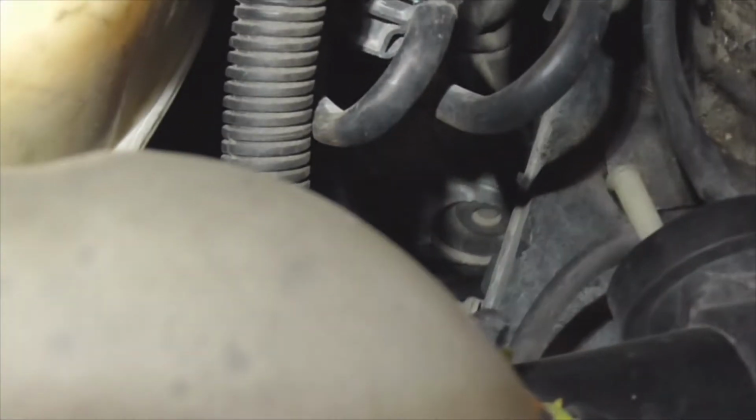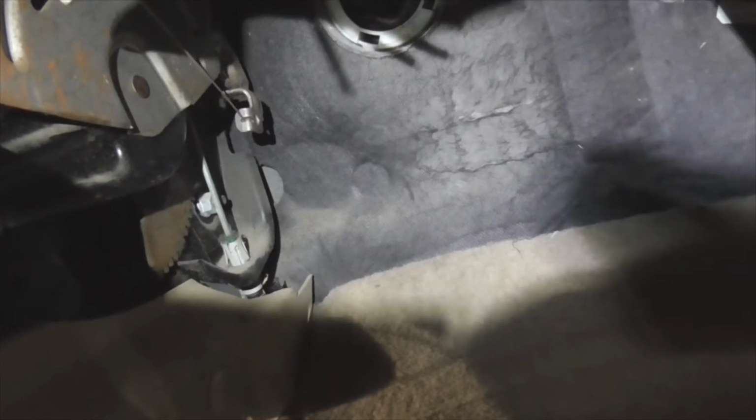It's going to be located just below where the engine harness passes through the firewall. So it's going to be right there. I'm trying to get it to where you guys can see. What I'm going to do is take off these panels, peel back that sound deadening material, remove the grommet, cut a hole, leave it snug for the power wire, and run the power wire behind this sound deadening material so that you can't see it from the inside. Come this way along, use the fish tape to pull it back, and run everything just the same way we ran the preamp and remote wire.